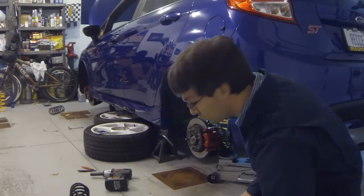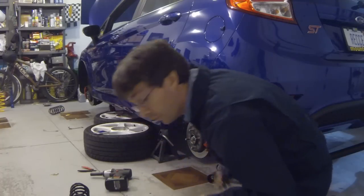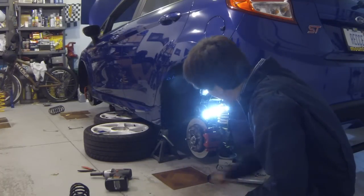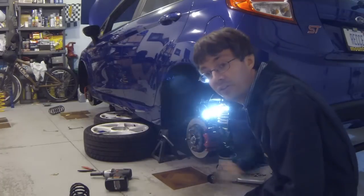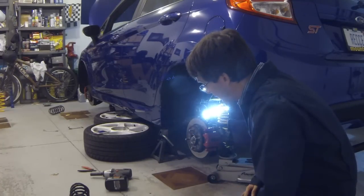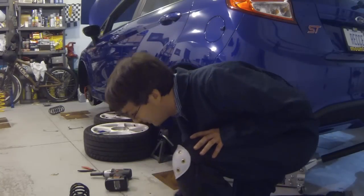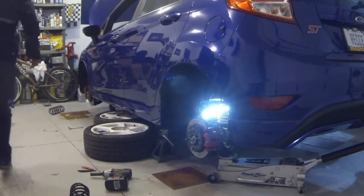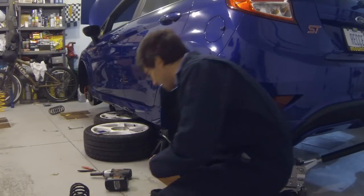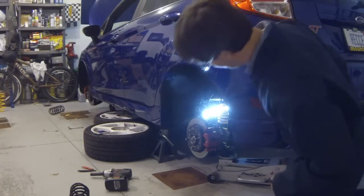So now we're actually going to raise the suspension back up to put in the shock bolt, but we'll not torque it down until we are closer to ride height. So I'll actually raise the suspension up for the final torque. But for right now, I'll be able to get the components assembled. And I'm gonna get some new fresh Loctite to put on the bolt, so hold on 1 second. All right, I got my trusty Ford thread locker here. So we'll use a little of that. That's the blue Loctite. So first, we're gonna raise up the suspension.